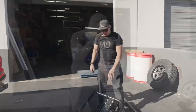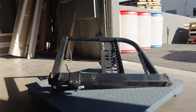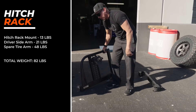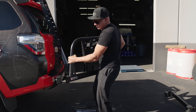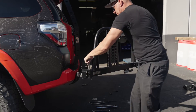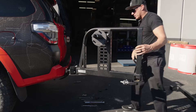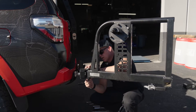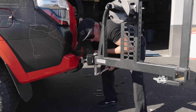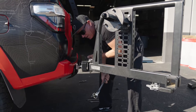We're going to install the other arm — the tire arm. The tire arm is configured on the driver's side. This arm as you see it, with the arm on it, comes in at 48 pounds. It also has our camera relocation bracket on it, which slides onto the factory hub. We slide this in and take the bolt into place, pushing pressure on it as we shake it down. The nut and bolt are both 15/16ths. Using a breaker bar and a 15/16 open-end wrench, I put a final tighten on that.